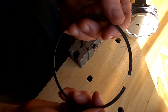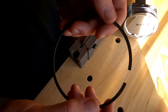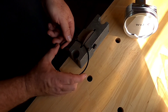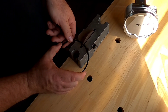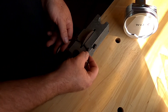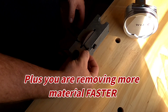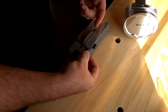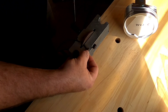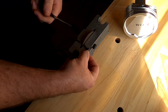Make sure that the writing is on top, or the dimple is on top, to make sure that you're grinding on the top side of the surface. Some people try to squeeze the ring together and grind both halves, but I find it's better to just grind on one edge because you know that one is perfectly square from the factory. Also, when you're turning the wheel, make sure you're turning into the ring itself. When you first start out, do it only for about 10 seconds at a time because you can remove a lot of material in a short amount of time.